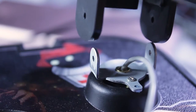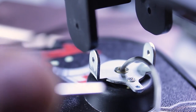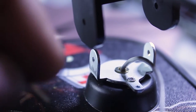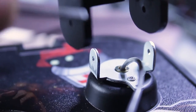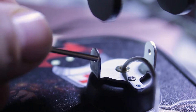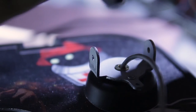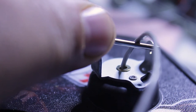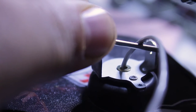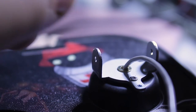We've got our tonearm in place. Remember, you're going to want the larger hole side of the little crossbar on the left-hand side. It's going to be tricky because you've got to get it through the tonearm first, then through this hole, then that hole, then the other side of the tonearm. Just make sure you bring your crossbar underneath the wire so the wire holds it up and guides it along the tonearm more cleanly.